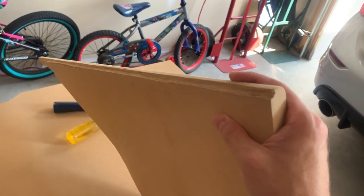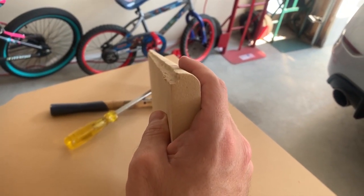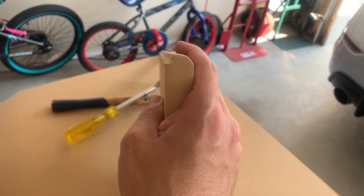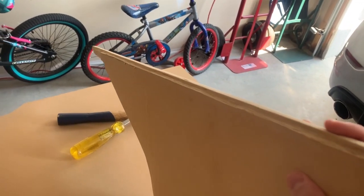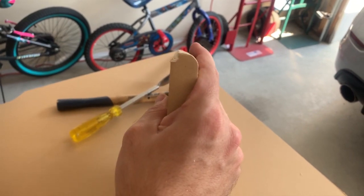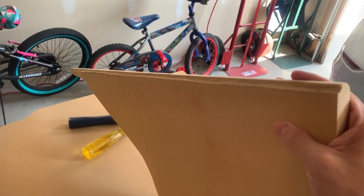After six broken cut-off discs, as you saw, I finally got my recessed edge, my bevel. It's done. So now when I go to wrap the fleece around, it'll have a nice area to recess into, so there's not all this awkward lumpy edging when I go to apply the resin. It's not clean, it's not neat by any means, but it'll get the job done for not having a router. With that said, I'm gonna stop here and I'll pick back up on another day.